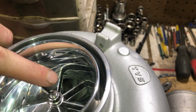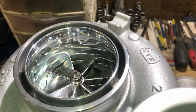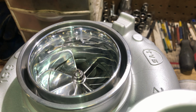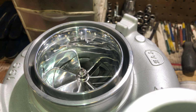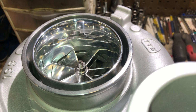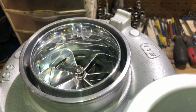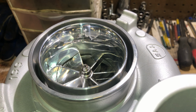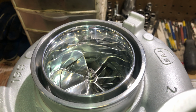The reason is because you're just moving the groove either up or down, which is going to limit how much pressure it's allowing to escape. So if the groove depth is farther down and it's wider as well, then you're going to allow a lot more air to escape, which could be a bad thing and hurt performance. So I tried to figure out a place to put it, and a width dimension, that isn't going to be overkill and make this turbo make less power than it should.